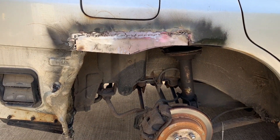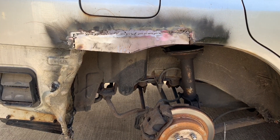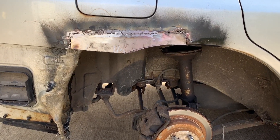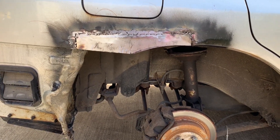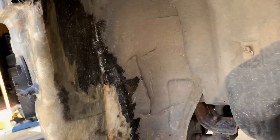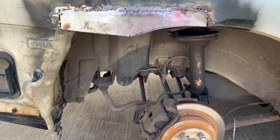I got this back quarter shaped. Next step is to do some body filler, then get it all closed in, and after that we're damn near done. I still need to cover up the back because there's still some gap there that I need to deal with — I'll probably just do fiberglass throughout there like I did everywhere else, just because it won't be seen and it'll be watertight.